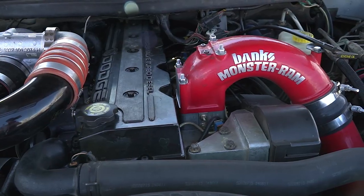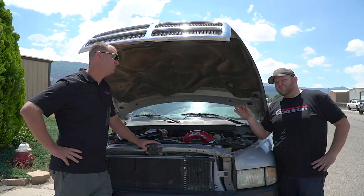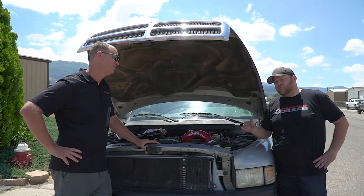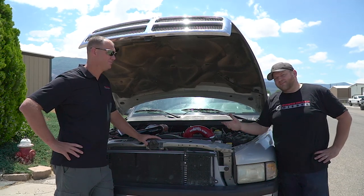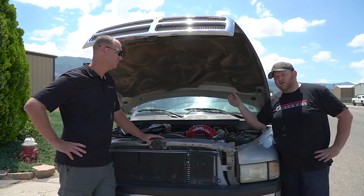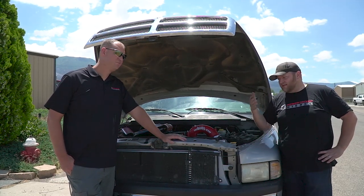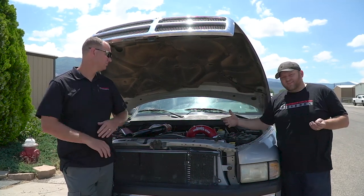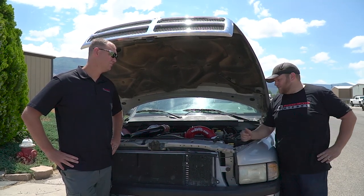Let me tell you a little about the VP44. I used to have a '99 and I did everything I could to get over 500 horsepower — I never quite got there, I got to 499. If you make more than 500 horsepower with a VP44 on a real dyno like a Mustang, you're doing something special. Back in the day they used to make a hot rod VP44 — a high output cam with a standard output plunger assembly — that gave you a quick injection rate and the same volume of fuel as a stock output. They didn't really add very much power; they felt peppy, but around 500 horse they're all kind of about the same.